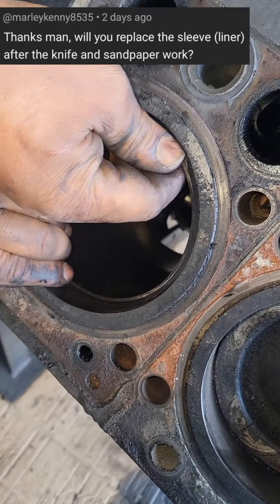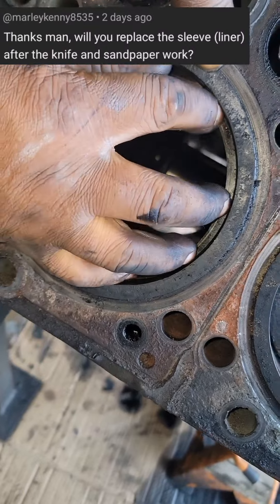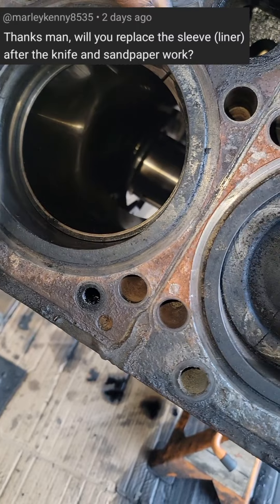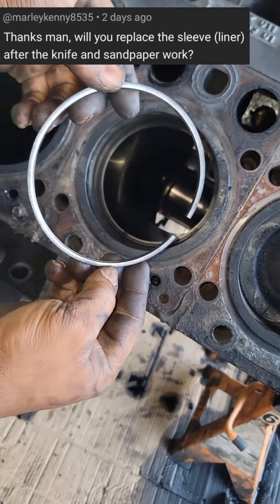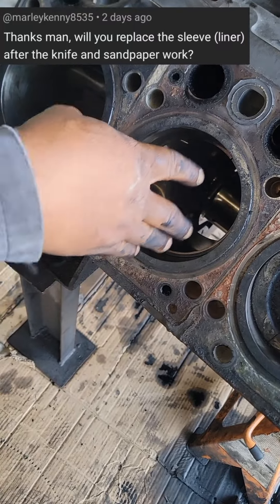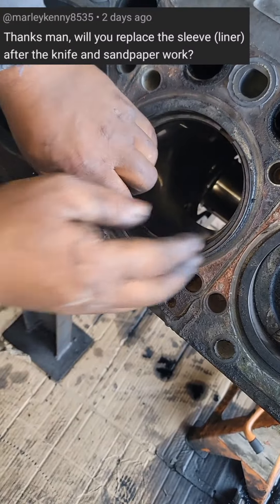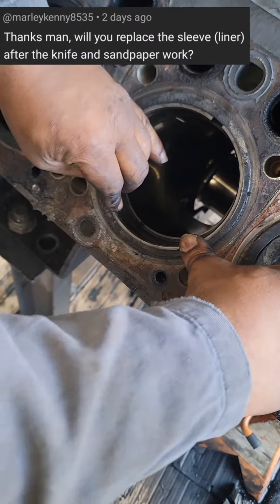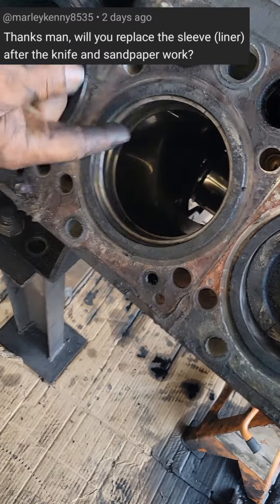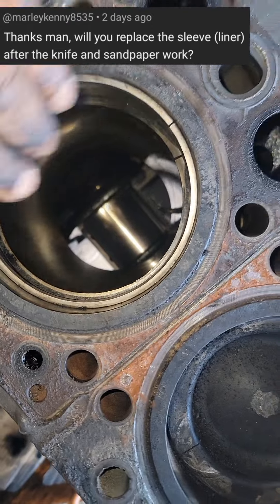These are two different rings - this is the center ring and this is the upper ring. Remember when fixing the rings: the groove for the upper ring is facing outside, and the groove on the outer ring is facing inside. This groove should be facing outside like this on the piston. When you're fixing it on the sleeve, try to fix it the same way you're fixing it on the piston. You see, if you check, it is not different on the groove, so this sleeve can still work.